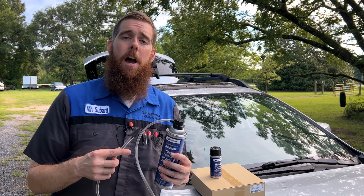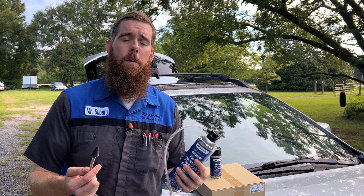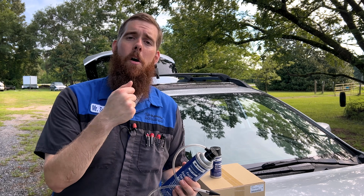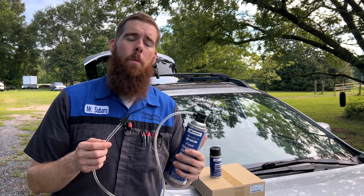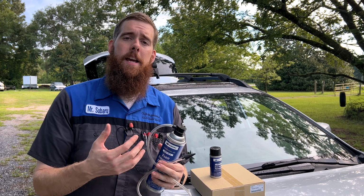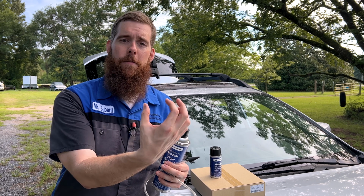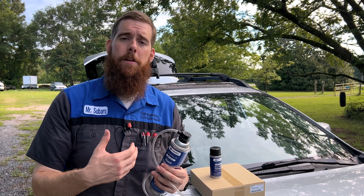Now, like I said, we're going to do it a little bit differently because it's easier for me to film and show you. What we're going to do is get in the car. We're going to pull the carpet back on the passenger side. We're going to pull the hose out of the firewall into the cabin. Then we're going to hook up and spray the foam cleaner in there. Once the foam cleaner is done being sprayed in from the can, they want you to put a catch can, a drain pan, to catch the foam once it breaks down the dirt and junk and flushes itself back out of the box. Now what we're going to do is just run the hose over into a catch pan.